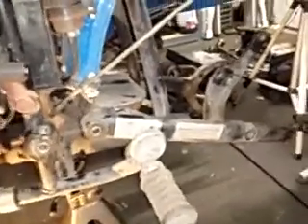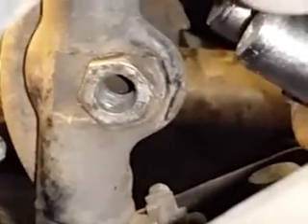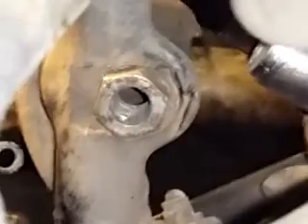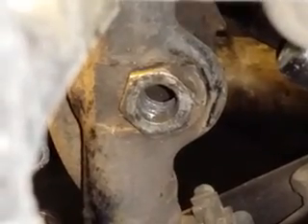I got the swing arm removed — slid back so it's out of the way. I got the drive shaft on the other side of that brake line, disengaged from the donut. There's that inside bushing right there. Do you see how the frame is kind of recessed around that nut? That's supposed to keep that nut from turning because it sits inside that recess, and I think it was 2014 that they did that — it makes the swing arm removal a lot easier.